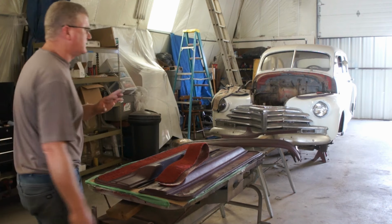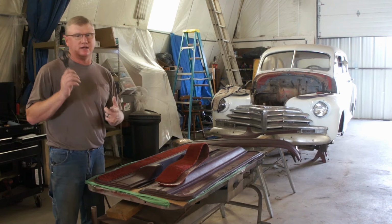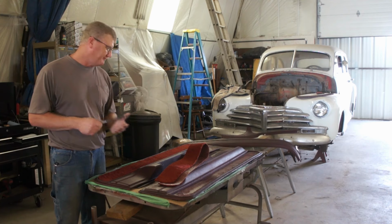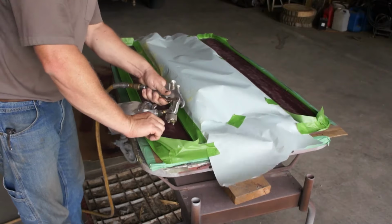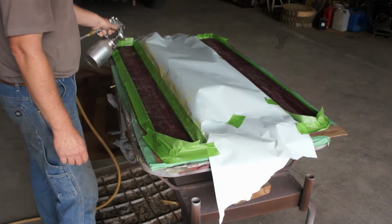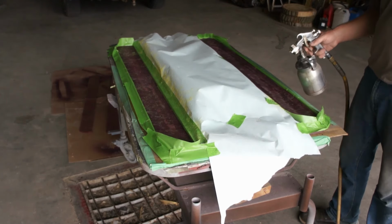And I have the hopes, I just know these people are going to come back. Door panels, especially the lowers, headliner, and seat covers. I just have that feeling I'm going to be working on this thing again. So I'm hoping that with just contact cement, I'm not going to bother stapling anything together like it was originally. If they come back and say, yeah, we want door panels, then with the use of some steam, some heat, hopefully I can release this contact cement and reuse these. Time will tell if that'll even happen. Seems to be a little bound up in there.